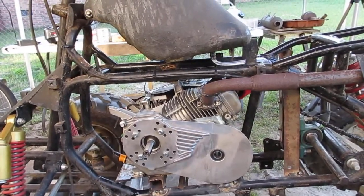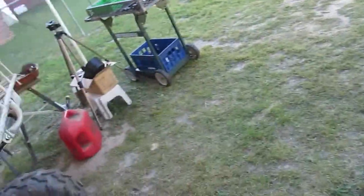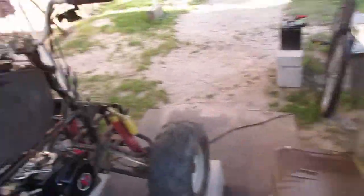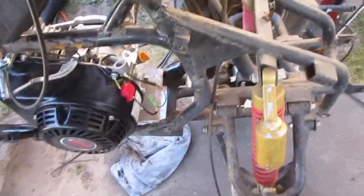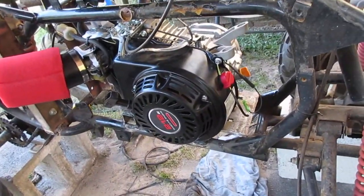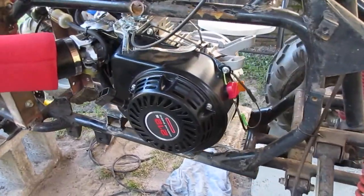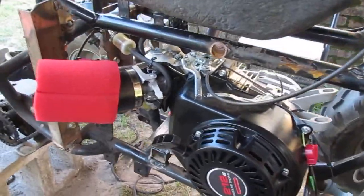The motor is sort of new — he didn't put a lot of time on it and it's still kind of breaking in. Later I'll go straight 30 for the hotter summer months, that's supposed to be the best. And if I want to ride this winter I'd switch back to 10-30. Of course if I really wanted to go high dollar, you can get 5-30 synthetic and that'll run any temperature range — that's according to Briggs and Stratton on their small air-cooled engines.